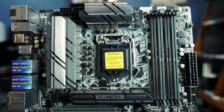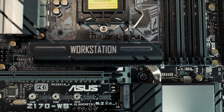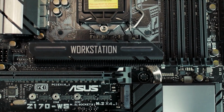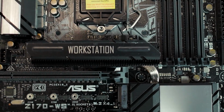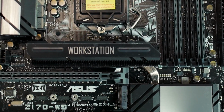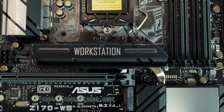In terms of heat management, the voltage regulation componentry has a substantial heat sink, both along the back, and then of course the north bridge has a heat pipe. Now, because ASUS has got to rock the heat pipe in order to keep everything cool, it is nice and low profile though, so if you did actually run this thing with 4 graphics cards, it looks as though the north bridge would actually get enough cooling because the heat pipe is sort of taken above the very top card. So as long as you've got sufficient cooling around your CPU socket.